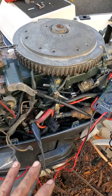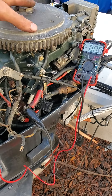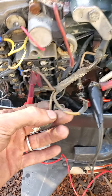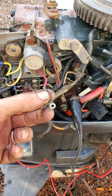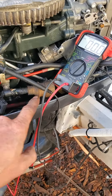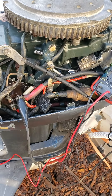For those of you that don't understand how all this works, all the two-stroke outboards and a lot of the four-strokes, they all generate AC. Most of the ignition systems run off AC power. The only time you get DC out of this whole thing is after the stator's two AC charging wires have gone through a regulator rectifier, and then there's a red that usually goes to the battery positive — which in this case is dangling over there. That's what charges the system. You can disconnect this completely, you can take the engine harness apart. God has created it such that when you spin magnets around coils of wire you generate electricity, and that's all that these things do.